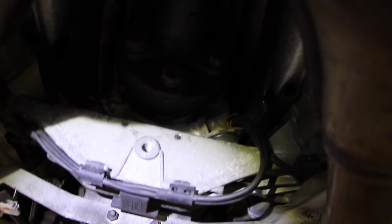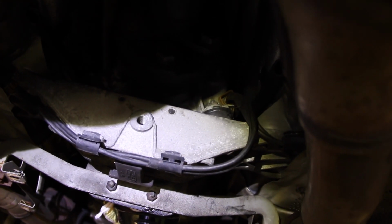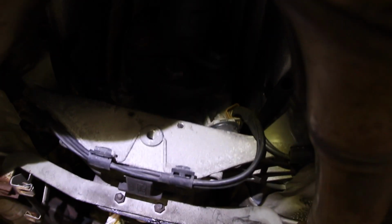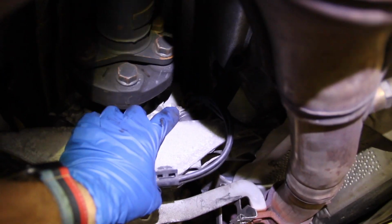As far as putting them in between the transmission and the brace, I found it easiest to use the tall stud on top to kind of seat that in the groove on the transmission, and then push the bottom stud up over the mount, and then just look in the bottom and feel around for it, and then push the lower threaded stud through the hole that it goes in. Then the only other thing that you've got to line up is the nipples on top so they sit in that gap on the transmission.